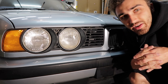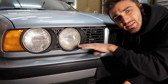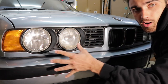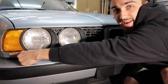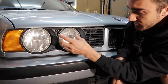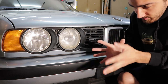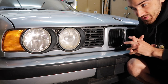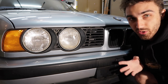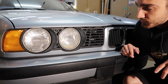For the final exterior aspect in this video, we're replacing the headlight lens. You can see there's a crack which let water in, so now it's foggy with some yellow at the bottom. I've been dreading this because this front end has never been apart — the body lines are perfect. To do the lens replacement you have to get the trim out, and to get the trim out you have to get the front grill out. I went on the E34 net page to look up the right way to do it.